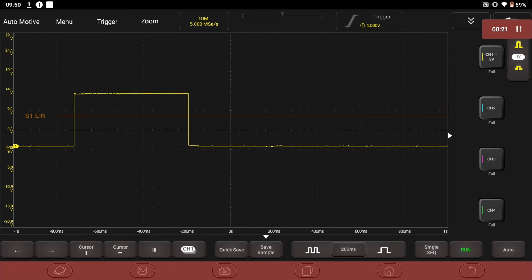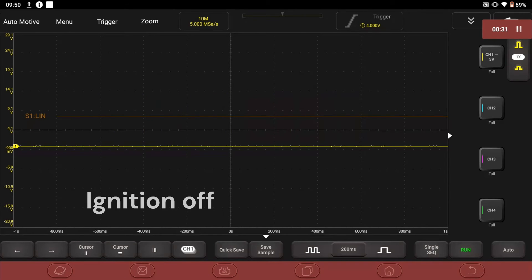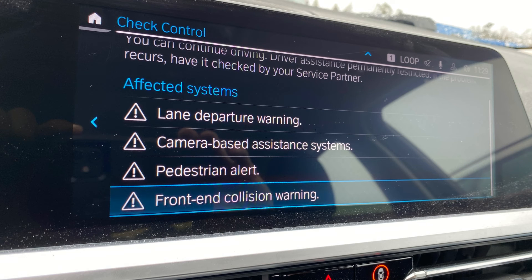When the ignition's on we can capture a lovely ignition-on frame from the BDC — which is what we saw in a previous image. Similarly, when we turn the ignition off we get more or less the same signal. So if you have a problem with a BDC — you've got live, you've got ground, everything's working electrically — but your camera doesn't work, try troubleshooting it. You might have a fault with the BDC. Thanks for watching, please subscribe.